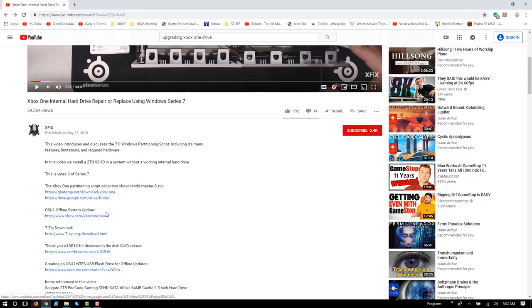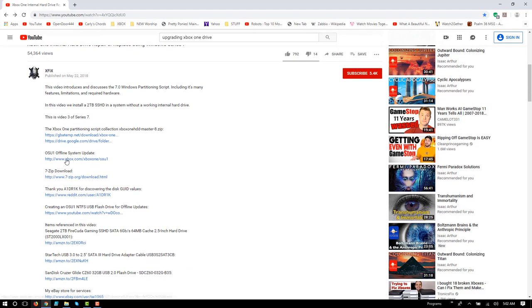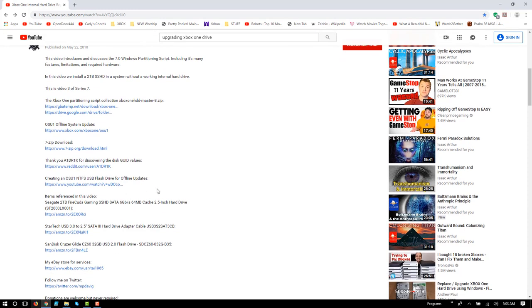So we'll download that, and I'm going to download this. For an offline system update, you'll just want to prepare a flash drive, format it as NTFS, and load these files on that drive for an offline update to the Xbox One. If you don't have a compression utility, then 7-Zip is a nice free compression utility. You'll need that. The GUIDs will be included in the packages, and he's just got some hardware here. Like, here's a video on how to create the flash drive, and maybe I'll go through that too.